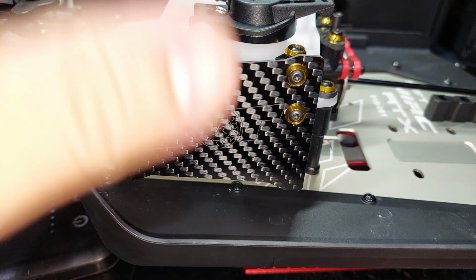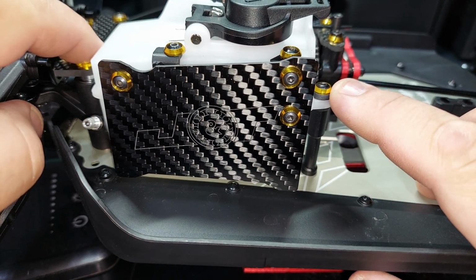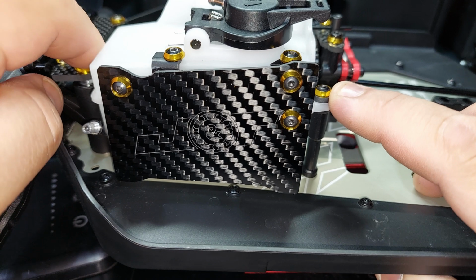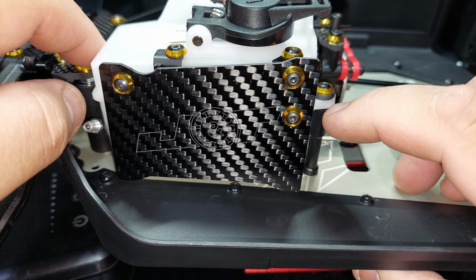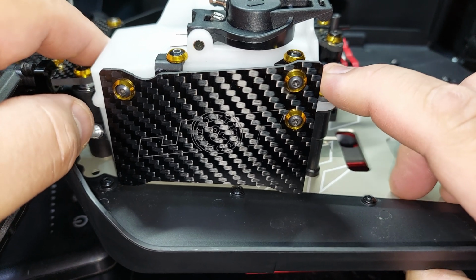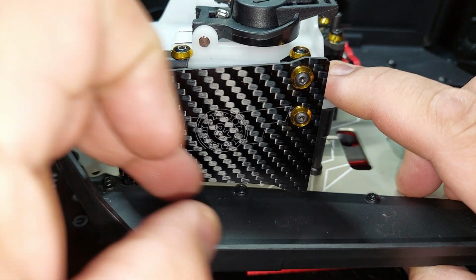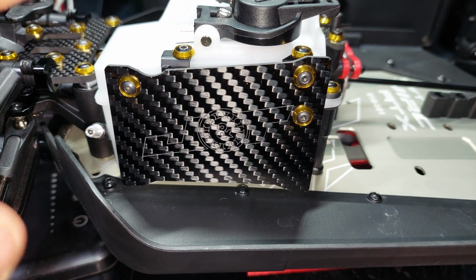Okay, so the tank is mounted, and I used some anodized washers that I ordered to get it secured the way I wanted to. Like I was telling you earlier, we do suggest you run some type of washer on the tank bushing here that goes between the tank and the post. It just secures it a lot better, and it keeps the tank from wanting to move a little bit, which had a tendency to get too close to the pipe because the clearance is really tight, which brings me to that.